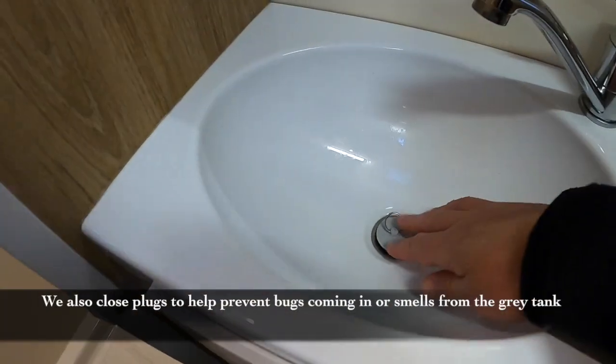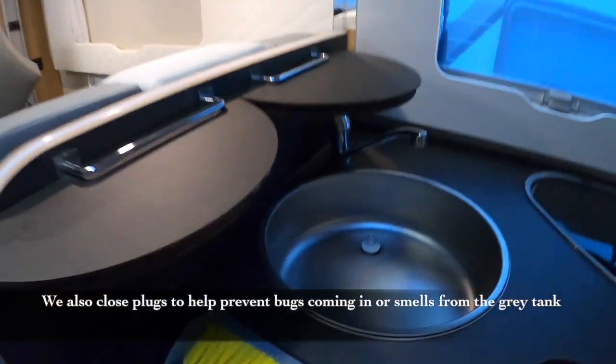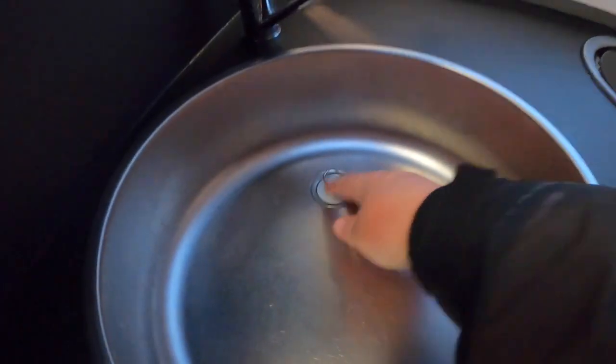Open your taps — both the bathroom tap, the shower, and the kitchen sink — and put the pump on to drain down your grey water so that any frost won't burst any of your pipes. When you've dumped all that fresh water from the main tank, make sure the water tank has also been drained down in an environmentally friendly way. Then we need to check that dreaded blue tap.